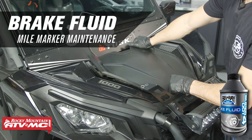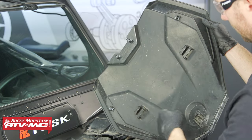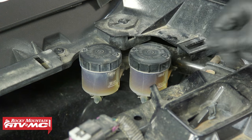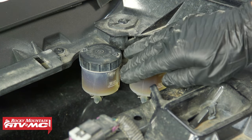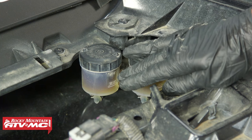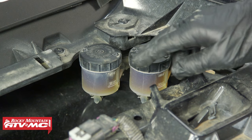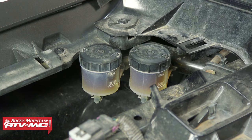For the brake fluid, remove the hood by releasing the few tabs holding it down. The brake fluid reservoirs are visible with minimum and maximum marks on each. Make sure the fluid is in the usable range — the level corresponds to brake pad life, so as pads wear the fluid gets lower. Be aware of that unless you have a leak, in which case the pedal will feel bad.